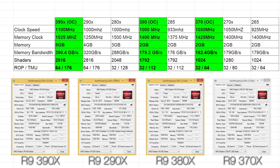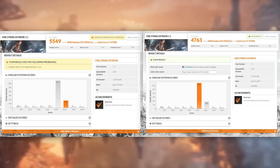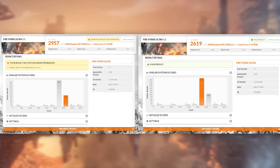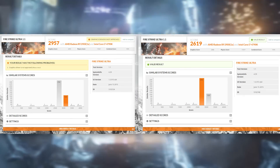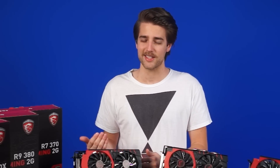The only real significant difference is between the 390X and the 290X, which made Anthony quite disappointed, but pleased at the same time since he only had to benchmark one new card. In Fire Strike Extreme, we're seeing an increase in score of about 16%. In Fire Strike Ultra, which runs at 4K, the difference is only 13%. For all intents and purposes, these cards perform about the same when you use less than 4GB of VRAM. The variation is most likely due to the factory overclock on the MSI 390X, which happens to be around 10% higher than reference — 1100MHz versus 1000MHz.